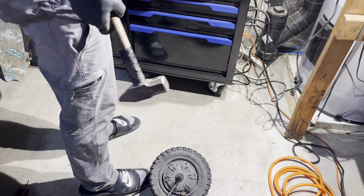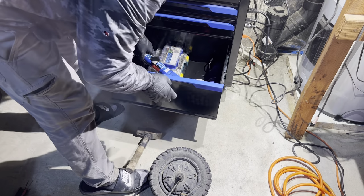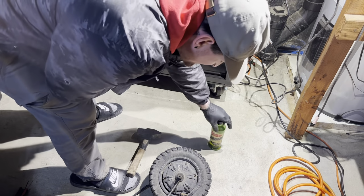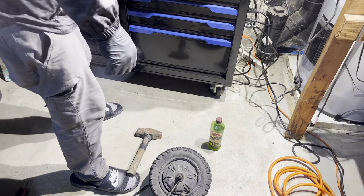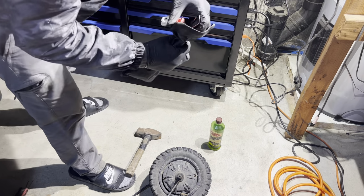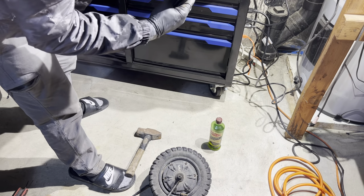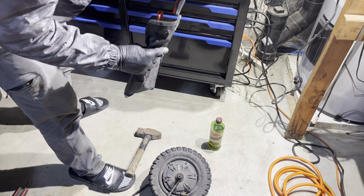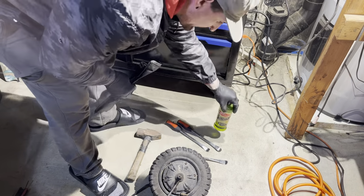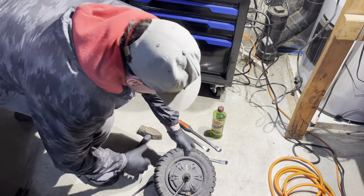I use a hammer normally to pop it off the bead. I've learned that olive oil is your best friend when changing these tires over, and also having some tire spoons around. These are just off Amazon. I'll put the link in the description if you're interested in getting some decent tire spoons for a decent price. But olive oil, I recommend olive oil like 100%. It's a game changer.